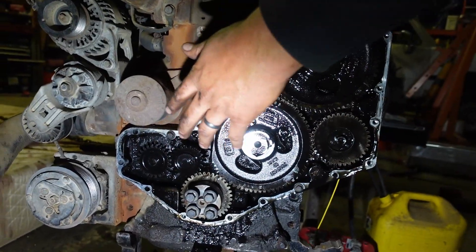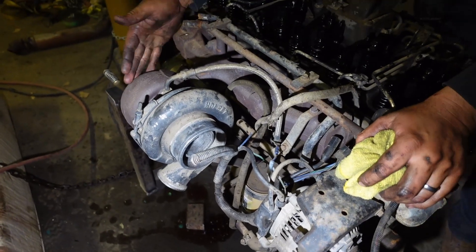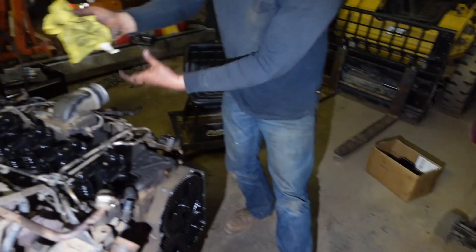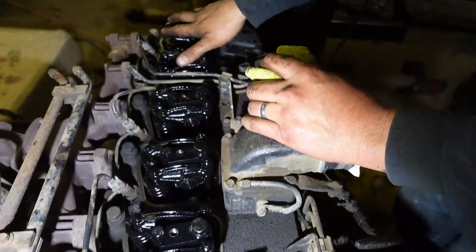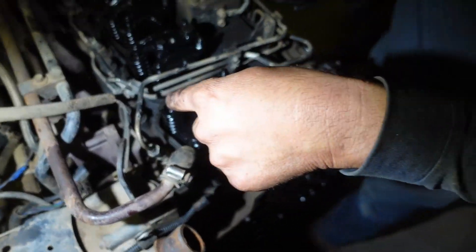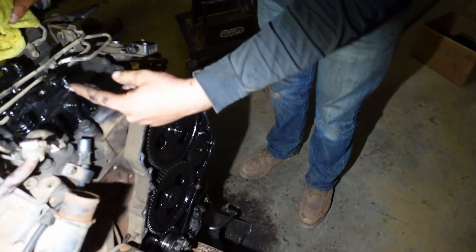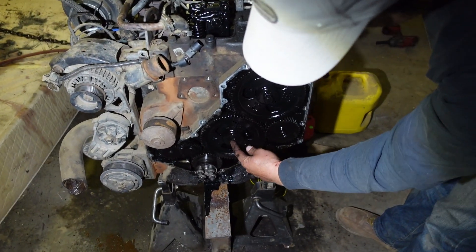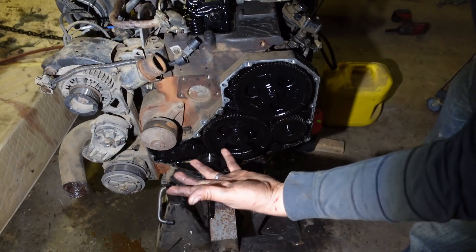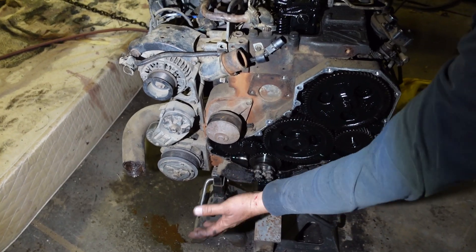This is why I love these motors — gear driven, chains can't stretch, none of that stuff, never need to replace them unless you actually break something. Over on this side of the engine you've got your exhaust manifold and your turbo — in our case this is a little baby turbo, like training wheels. Air comes in here, goes around the intercooler, comes back up into the intake horn right here. The valve train is super basic — just two valves per cylinder. These ones are the exhaust ones, these are the intake ones. The push rods come down and the cam is run off of this gear. This gear hooks up to your injection pump, this is your power steering slash vacuum pump, and this is your oil pump. Water pump is belt driven, air compressor is belt driven, alternator is belt driven — all comes off the harmonic balancer.